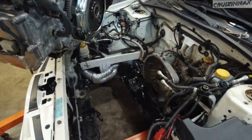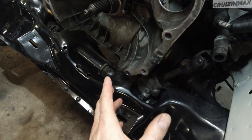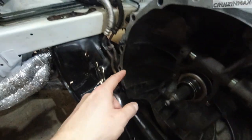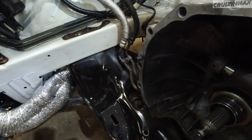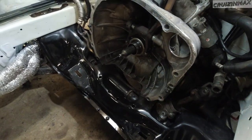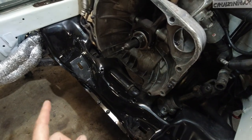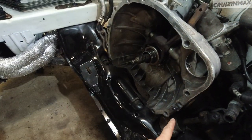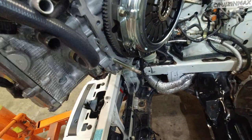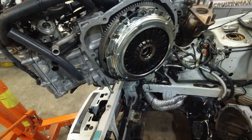So I took the engine out. Well, it was never in all the way. I knew about these two pins. See, there's one pin and there is another. These are two guide pins. When I took my engine out, the original block, remember this one is from a WRX, the engine took one pin and one stayed. So I was missing a pin on the transmission, and this WRX block did not have any pins. I knew about it, but I forgot about it.